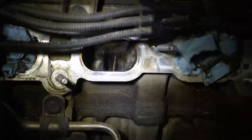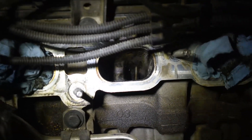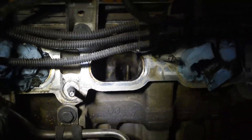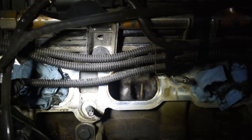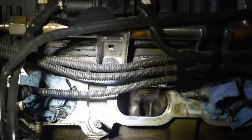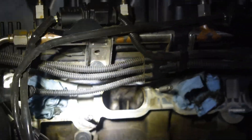After blasting everything out with air, you can see there's still a pretty decent bit of gunk built up in there, especially along the backside of the valves. This is about as far as you can get — or at least as far as I could get — with the walnut shells themselves. This is where the brake cleaner or carb cleaner comes into play.